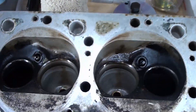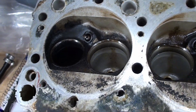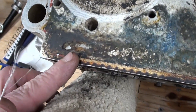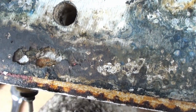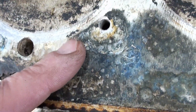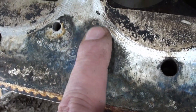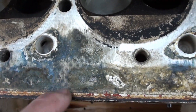So all the valves are out of this first head — the passenger side, the one that was date stamped 1986, the one they replaced. Look at this — when I'm getting a close inspection, I mean, this is a divot. Like a chunk of metal gone. I'm also seeing that I bet you this is not even within tolerances. I would say that this is not a great seal.